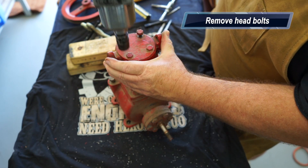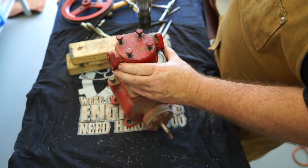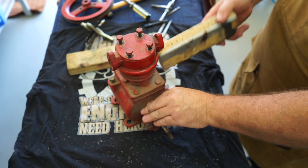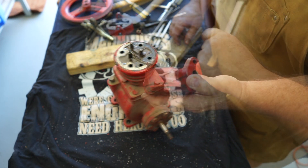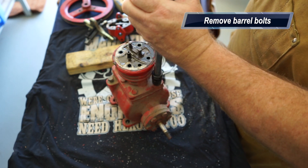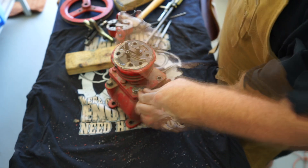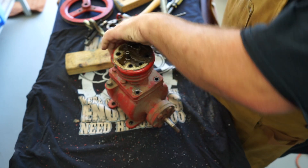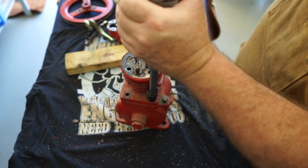Using the rattle gun to remove the cylinder head bolts and giving it a light tap. This removed the top part of the cylinder head; however the reed valves were still stuck there and came off later when I belted it from inside the barrel. When removing the barrel bolts I actually broke one — it snapped in the crankcase housing, so I'll have to show you how I got that out throughout the video.